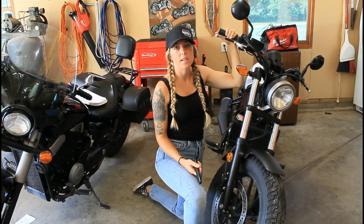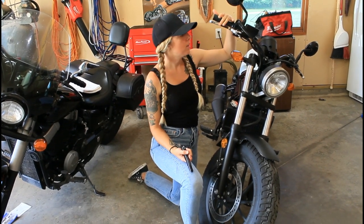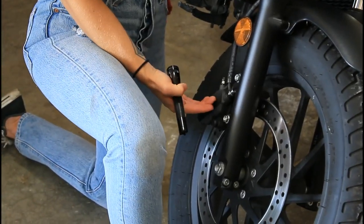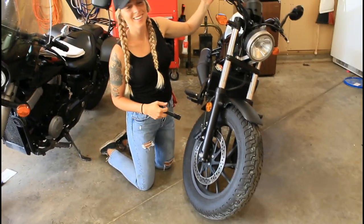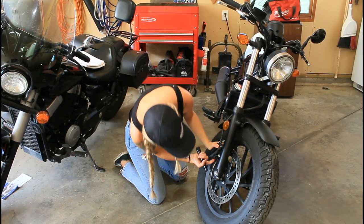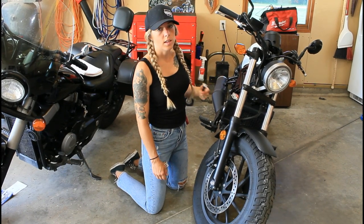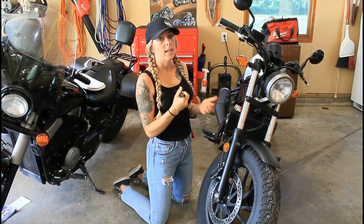Checking your brakes — more specifically your brake pads. First, make sure your brakes are working. You want to check the pad from below the caliper, or wherever you can best see the pad. Take a flashlight and look wherever you can best see the brake pad — they've got wear indicators on there. If they're worn to the wear indicator, it's time for a new set of brake pads. Same for the rear — they're usually positioned on the rear right. If the pads are worn to the wear indicator, get yourself a new set.